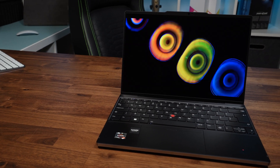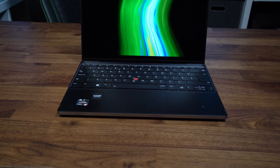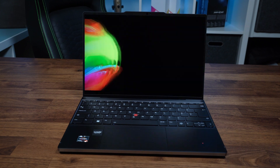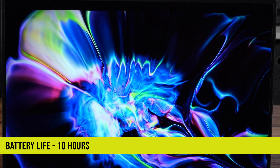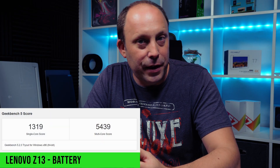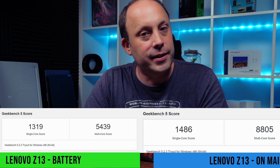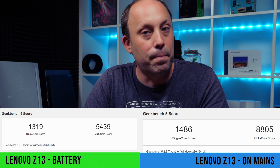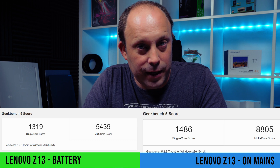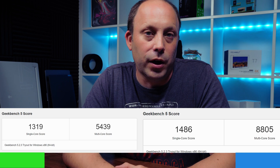When it comes to battery life we're getting great results. In our usual Wi-Fi streaming test at 50% brightness and 50% speaker volume, we scored just under 10 hours of battery life — really impressive and well ahead of the XPS 13 we tested recently. Ryzen does throttle back on battery: single-threaded performance was pretty good at just under 10% less than on mains, but multi-core scores are hurt by about 40%. I think they've got the balance right — I'd rather have slightly throttled performance in exchange for that extra battery life.